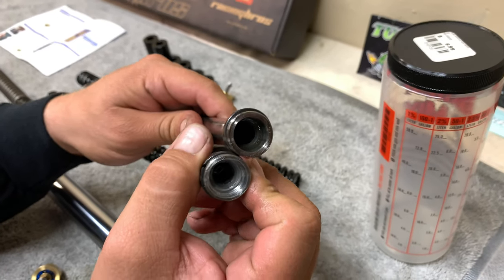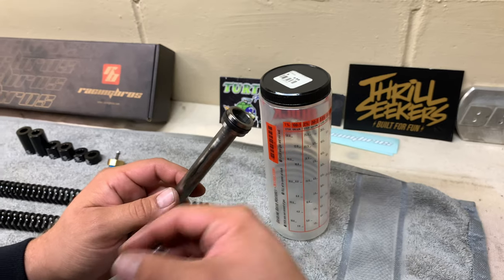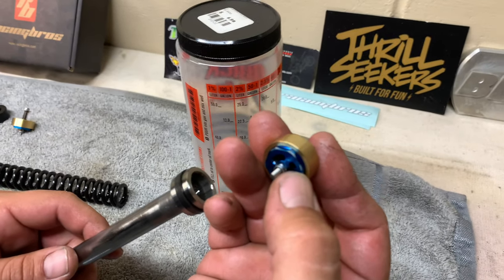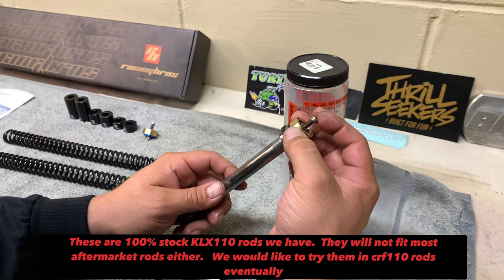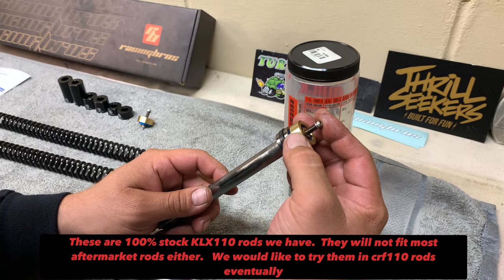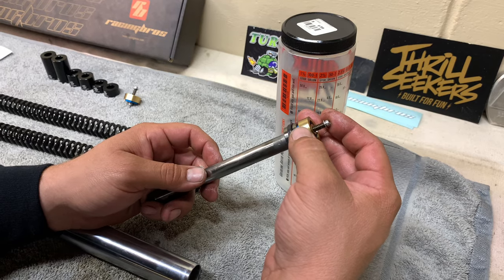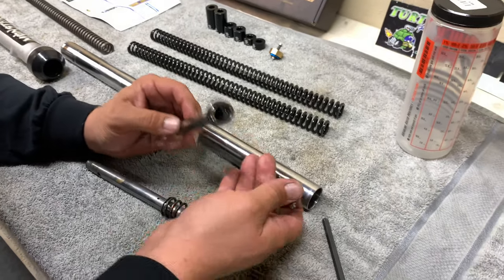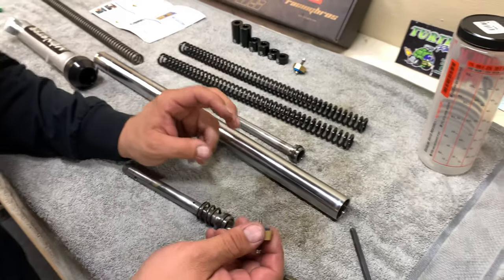On the unmodified rod, this valve won't sit in there. We tried dropping them in without modifying it — just sitting on top — and you can see it started to wear after about two laps around a track. Could you just stuff them in there and do they actually work that way? Yeah, they do work pretty well that way — better than straight up 20 weight and two stiff springs. But with the proper install, there's actual rebound on it, more like an inverted fork. You actually get some rebound squish instead of it just being like a hard pogo stick.